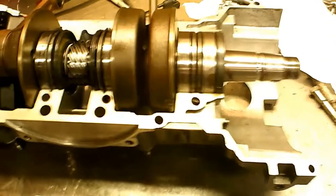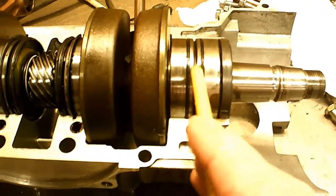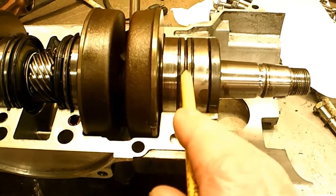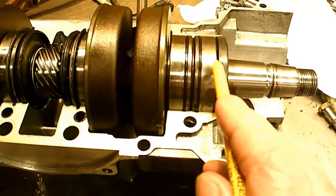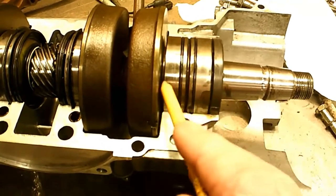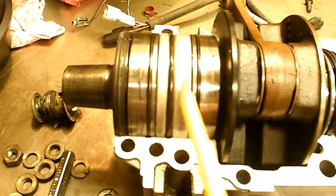What I intend to change is this spacer in here — I did it on my Chinook, and it's only run 25 hours, but I haven't had any problem with that. So I intend to put in a spacer that's not so big in diameter that it covers up those balls. These two rows of balls will be open then, and air and oil mixture can get across between them all, because it's all mounted inside of a tube. I don't know about this side, but I'll have a look at this too to see what this is.